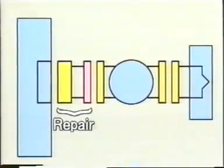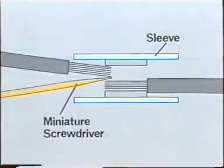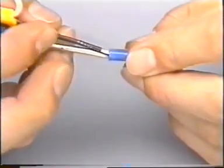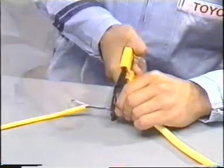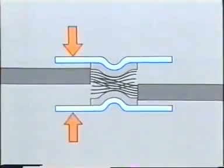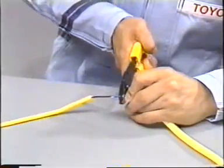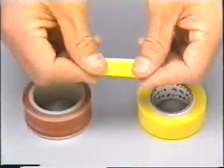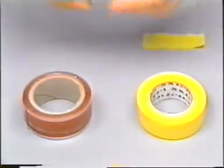This trouble can be corrected by repairing the harness between the center airbag sensor assembly and the spiral cable. Let's quickly look at how to repair the assembly. First, put the two open ends of the wire harness through a sleeve, like this. Then, making certain that the two ends are connected correctly, fasten the sleeve by using a crimping tool. To secure and protect the joined connection, ordinary electrical tape and silicone tape are used.